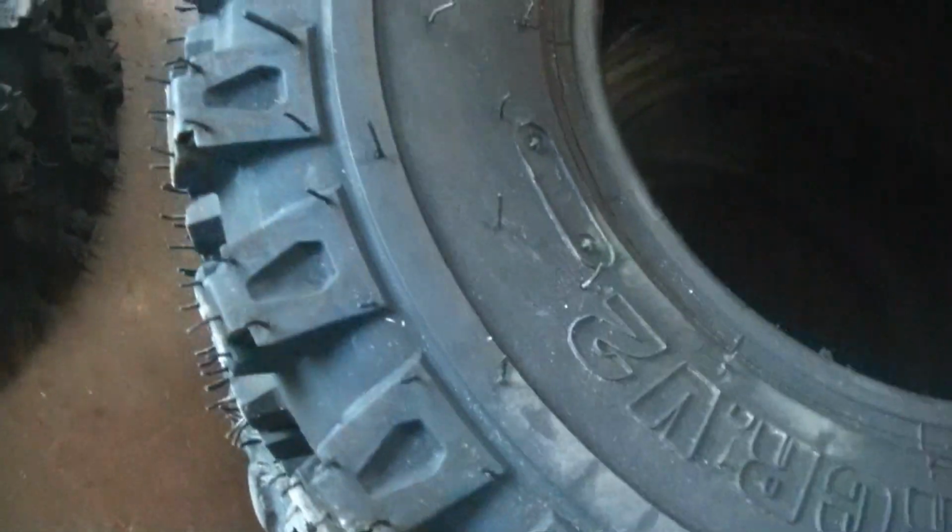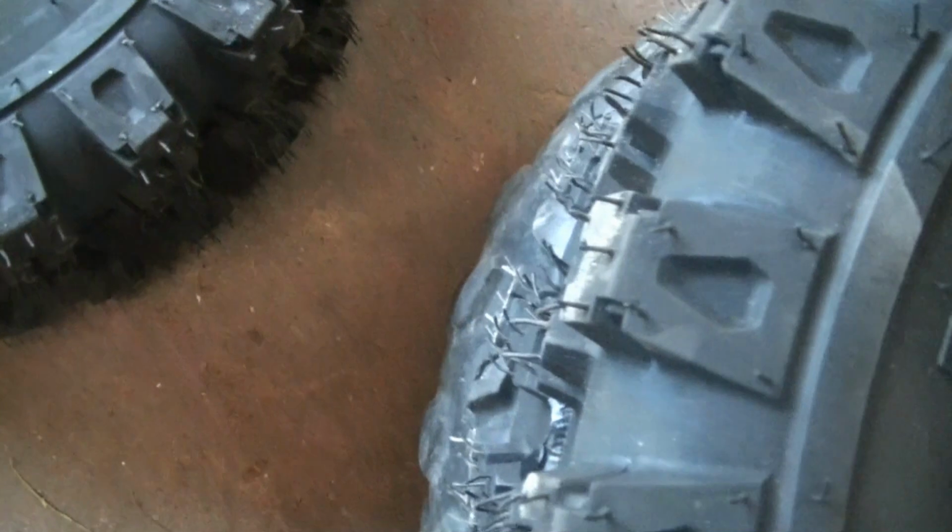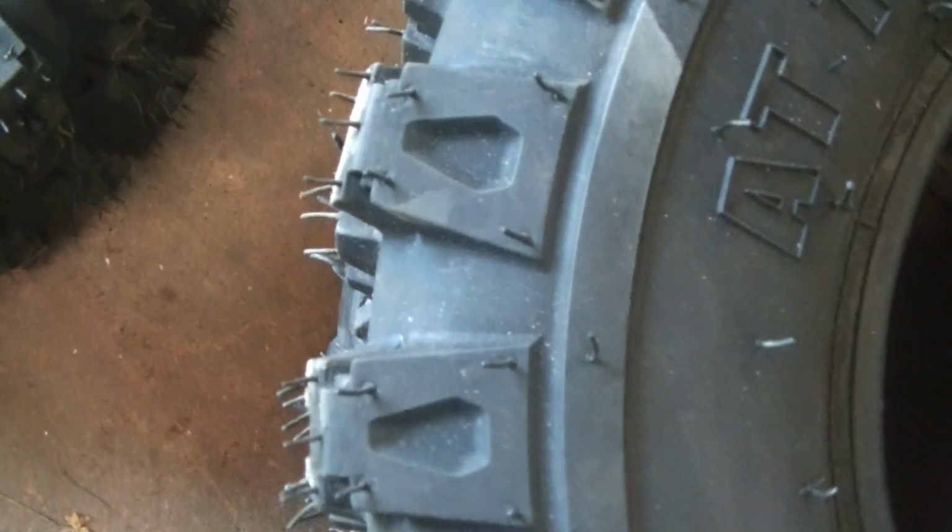Okay, now that I got the chain back on and the cover back on, we're going to focus on the back wheels. These are 30 years old. These are probably the original tires. There's not much left of the knobs on them. We got these ones. They're just a hair smaller. DWT, they're 18 by 7/8 instead of 19 by 7/8, but they're a much flatter, squarer tire, which is hopefully going to be better for racing. So we're going to go ahead and get those on the rims.